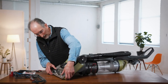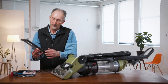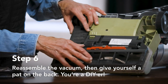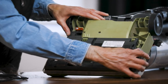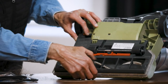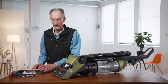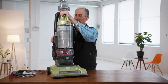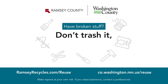If you hear noises, you may want to check again for safety pins, paper clips, or things like that. Then with these, there are little slots for this cover assembly to go back in, and it snaps down into place. Don't force it because being plastic, it could break. We just slide these back and it looks good. We don't hear any noises, so I think we've completed cleaning out this vacuum cleaner. You can put it back into service and check it out — make sure it works. You can learn more about fixing everyday items at these websites.